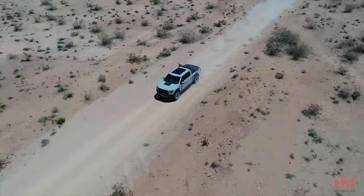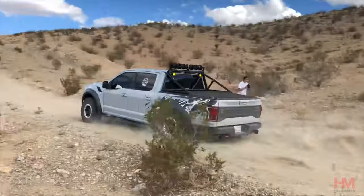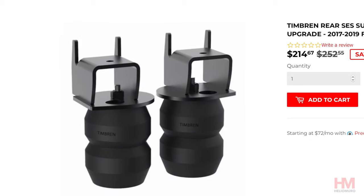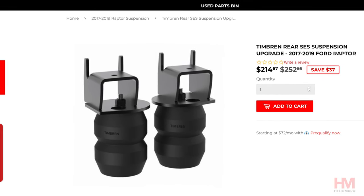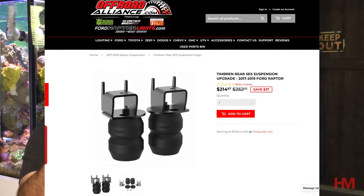Going fast with the Raptor is very addictive, and you're eventually going to be at full tuck somewhere in that back end, and you're going to need more protection. Now you have a couple of options when it comes to upgrades here. You can go with an enlarged rubber bump stop, though they can get very pricey. I'll show you guys one right here — it'll basically extend that length and give you more protection than just the silly little inch you get from the factory.